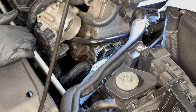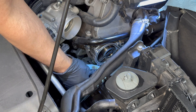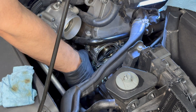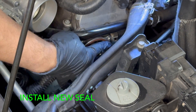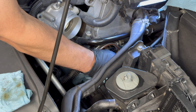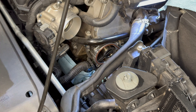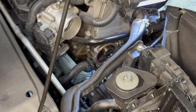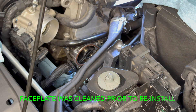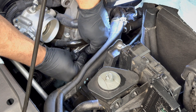Make sure you put the new gasket in place and get the faceplate back on before oil starts dripping out. Get the rag out of there, walk the gasket in — there it is. Give it one more clean, then bring the faceplate back in. Don't worry about how dirty the outside is right now — that gets cleaned afterwards.